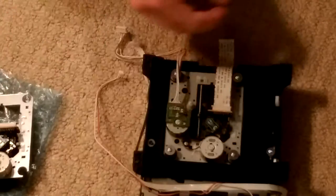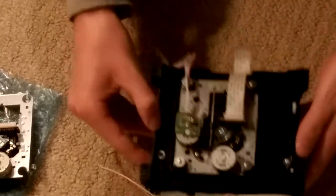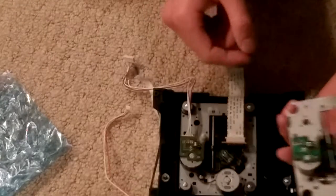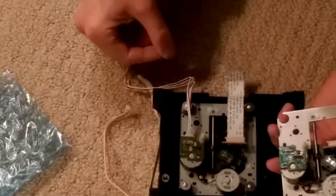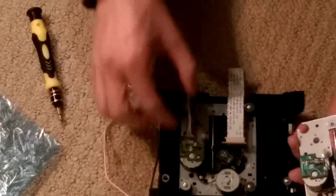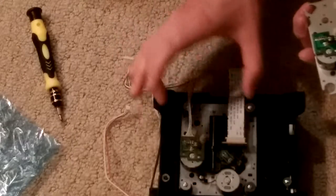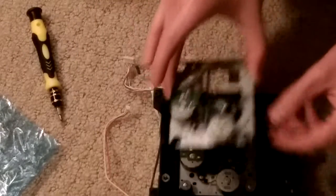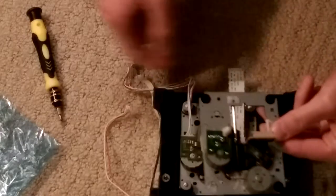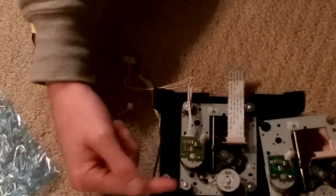Once you have removed the screws from the nuts, the CD drive will actually pop out really easily. Go ahead and remove that, and just for the sake of not having to take these wires out — because I already replaced this lens — what you do is pull this wire and this wire out, then unscrew the four points here. Basically it's a washer, a spring, and then another rubber washer that you'll have to pull apart. At that point the optical lens housing will pull right out, and you'll go ahead and just place the newer optical lens frame into the housing and replace these wires.